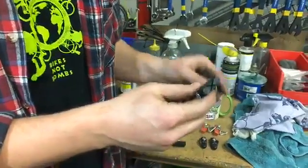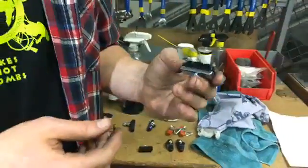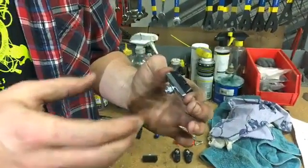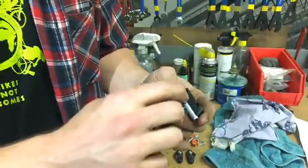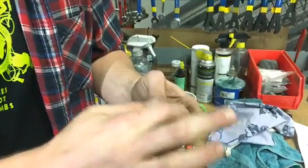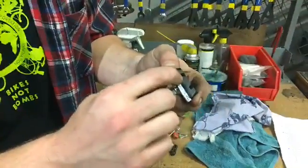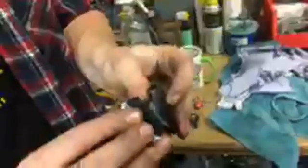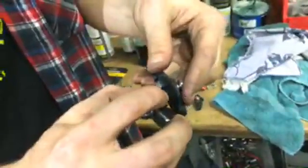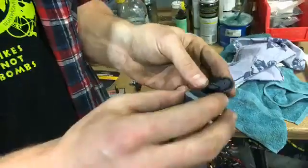And so the main thing that you want to understand about brake pads is when they need to be replaced. So the thing that you're going to notice is that when you squeeze your brake, it's moving a lot more. You get a lot more travel on the brake lever, and you're just not stopping that well. And it's very likely that your pads are wearing down. So the friction of the brake has worn away this rubber, and so they'll wear thin. I should have grabbed an example of a really worn one, but I wanted to show you these lines here. So when these lines, and you'll see different types on different brake pads, when those wear all the way down, then it's a good time to replace your pads. It means you've used up all the meat in the brake pad, and it needs to get changed.